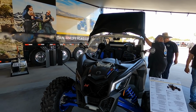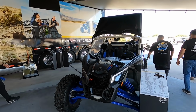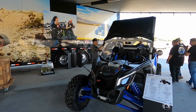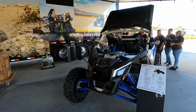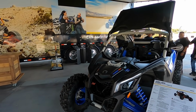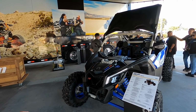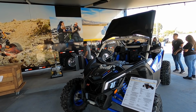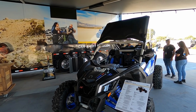Did you guys make changes based off maybe the race program, or maybe just... It's because of the bigger tires too. We put some 32-inch tires. This is why we needed to make those reinforcements for the vehicle. And we know that consumers who buy a car like 2018, 2019 were putting some big tires like this, 32, and at 32 there's more stress. That's the standard. There are some people that go up to 35 on it. So more stress on everything.